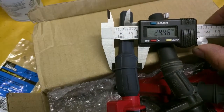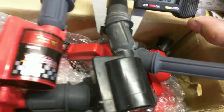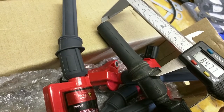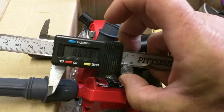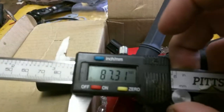Let's give you some measurements. We got 2379 on the Bravex and 2378 on the OEM, so they're about the same. Measuring the depth from the side of the arrow — the top of the flange — we're looking at 8533 for the OEM and 8731 for the Bravex, so they're a little bit longer.